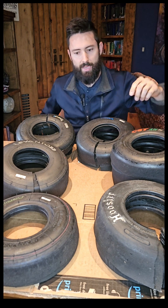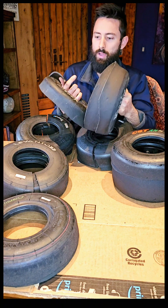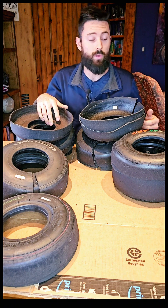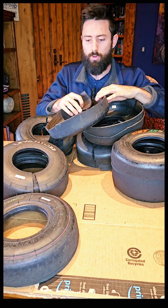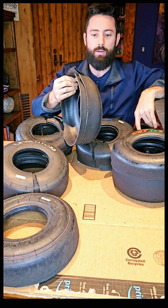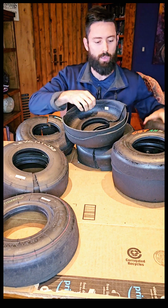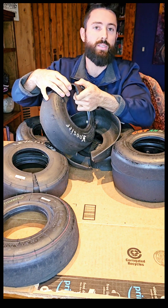The Hoosier is the first brand of tires we're talking about. I have an R70 cut up here just as an example of showing a sidewall. One thing I learned in this test is how important sidewall is and how a tire performs for the specific use we're putting it to. The R70 seemed to have great, very durable rubber, but the sidewall just doesn't have any bead filler — that chunk of extra rubber in this area. On other tires you can see that extra rubber, called the apex of the bead filler, which gives the sidewall extra reinforcement. That's why this one is real floppy and flimsy, while the ones with more material in that area are a little stiffer.